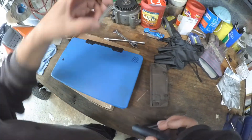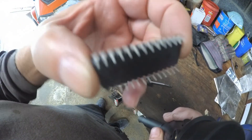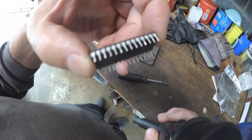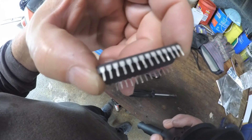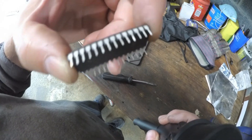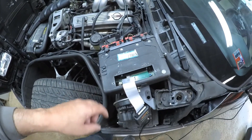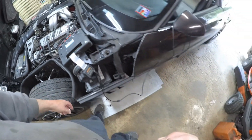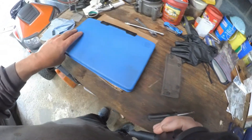The chip is out, and you see those little pins on there? Whenever you install them in and out of that adapter, you want to make sure they are perfectly straight — in every way — because otherwise they won't go in and they bend super easily, so you might have to play around with them to get them lined up correctly. I have the adapter in the car, I've got the power hooked back up to the ECM, and I'll go ahead and hook up my little netbook and we'll start the car and get everything going.